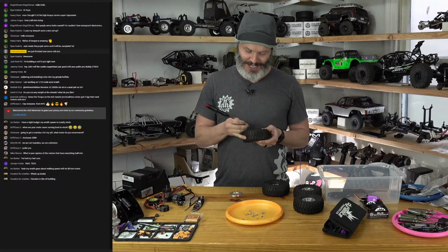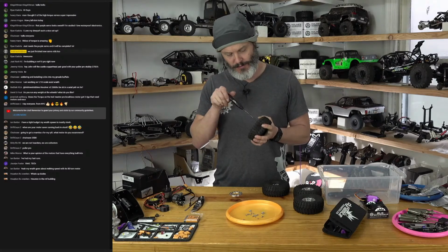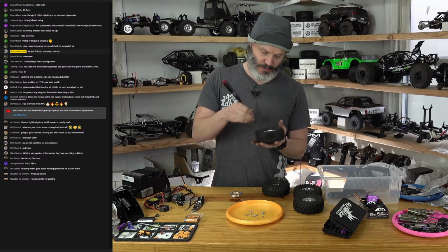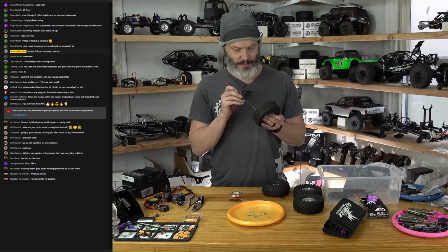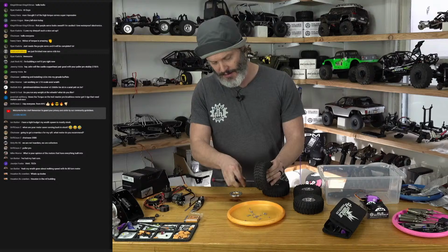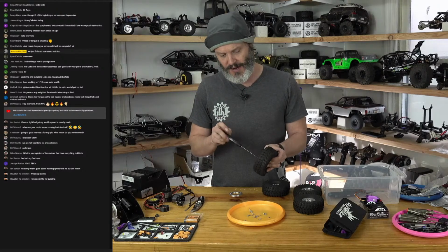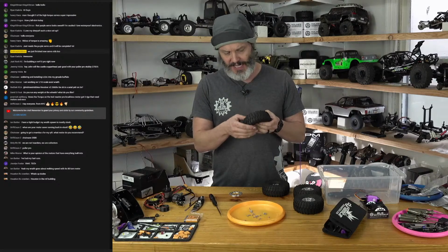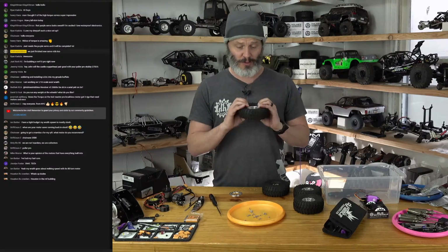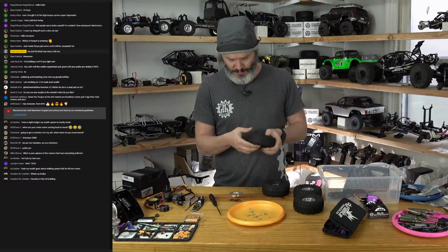Hey, speaking of opinions, what's your opinion on motors that have everything built into them? Is that like the Fusion maybe he's talking about? We have a viewer asking what I think about the Fusion, essentially the ESC built into the motor. And I think they do have their place. Obviously, people like them. I have a few Fusions behind me as well. The one gripe that I hear from people is that they don't have great torque density. They don't put down much power. Great, smooth for crawling, plenty for crawling. I mean, we use brushed motors that are relatively weak, and it gets the job done, right? But compared to other brushless setups, certainly compared to a Puller Pro and a Mamba X, the power on them is noticeably less. Noticeably a big difference in power.